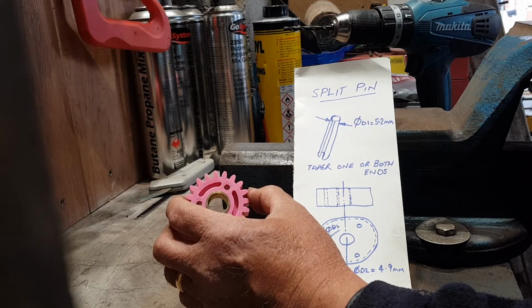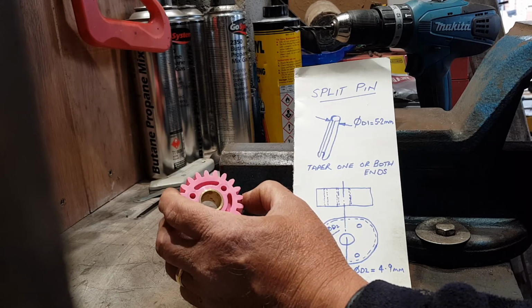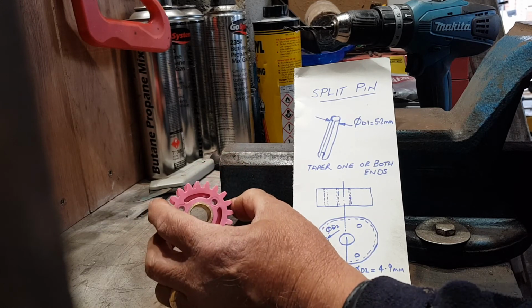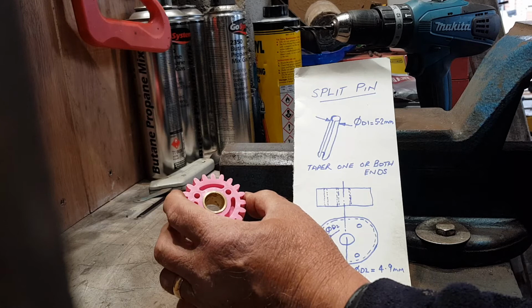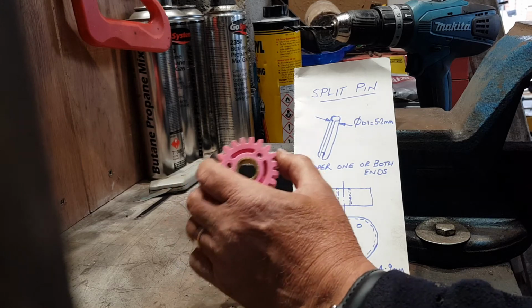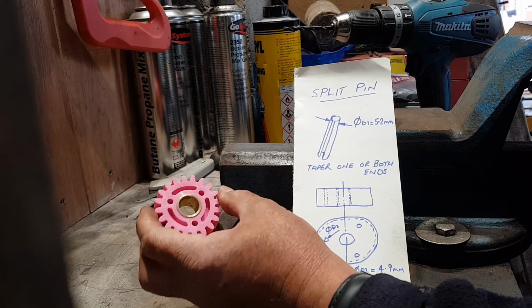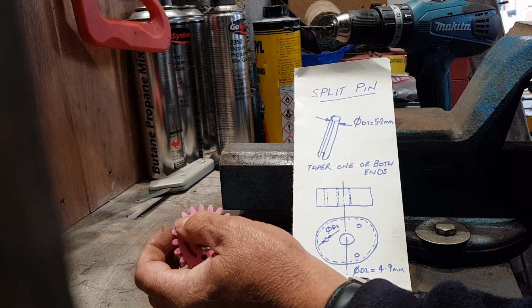So I've now used it 4 times. No problems, no sign of any problems. I did reassemble it with some silicone grease just to help things along a bit, but I truly believe that the problems that people are seeing with this shattering, yes, if you jam the blades up completely, it will be an issue and it will shatter, and it's designed to do that, let's face it. But I think we're exacerbating the problem by pre-stressing these whole areas in the position relative to the 3 pin holes.